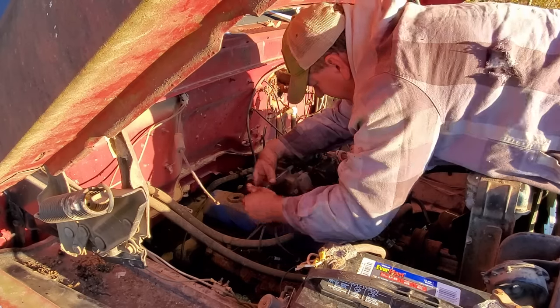So I got to looking a little bit further, and it's got a valve for an auxiliary tank, and it doesn't have an auxiliary tank. Let me show you underneath what I did. Right here is that valve for the auxiliary tank, and it doesn't have an auxiliary tank that's being used. This line right here is the one coming out of it. That line goes up to the front, and right here is where it came into the valve out of the tank. Well, I just bypassed that and went out of the tank to the line going up front.